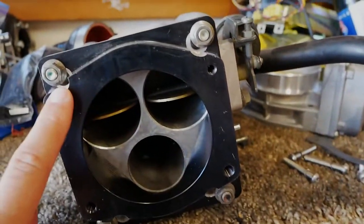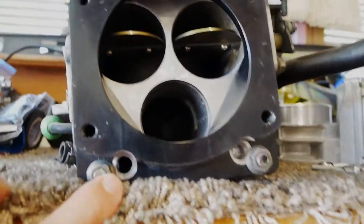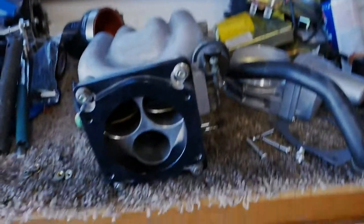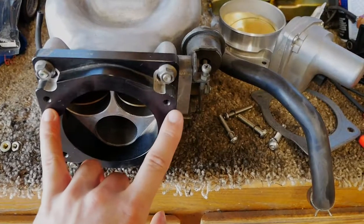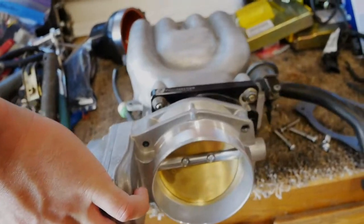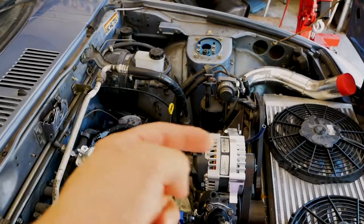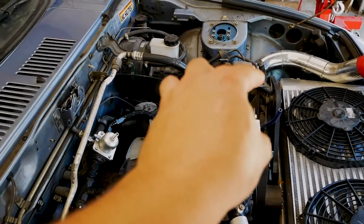Previously, I had redrilled all this out for a Series 5 FC RX-7. What they ended up doing now — that's a massive vacuum leak; you can see light coming out of there. The one downside of this FFE setup is you have small bolt holes here and large here, which makes it so this always comes out that way due to their bolt pattern setup. Really, the way it should always be is this way — instead of going this way and taking up all this room, it now goes back this way, which means you can actually put coils right here if you wanted to.